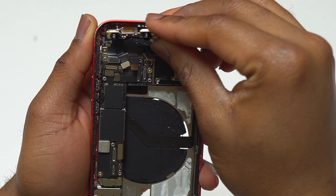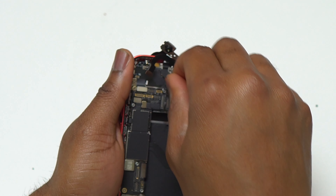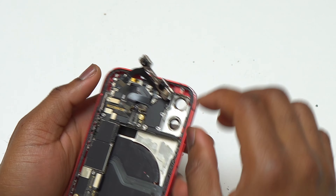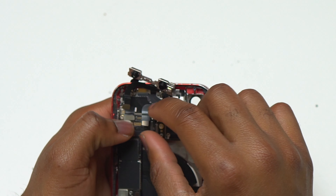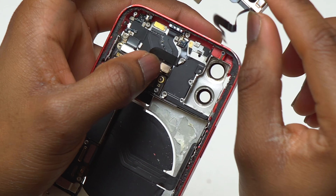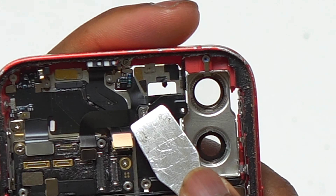I was able to track three cables, and that's when I disconnected the third cable still attached to the motherboard. I then saw that the third cable is attached to a cable going to the flashlight, so I removed the screws holding the flashlight component. After carefully looking at the Face ID component, I saw the cable is not really attached but only slightly glued to the camera flashlight cable, so the Face ID component has been removed.